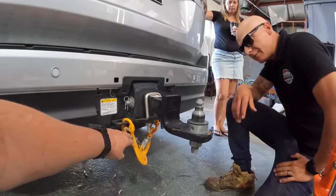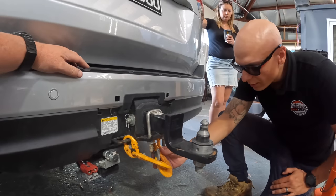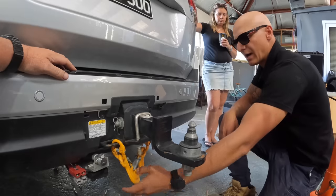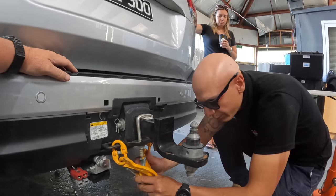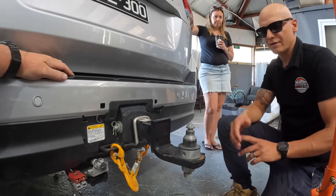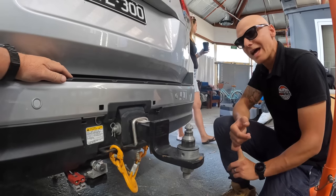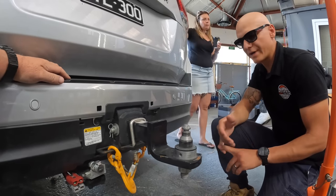Thank you. A couple of questions. These yellow ones here, are these illegal? I've been told that they are. If they're not, there's an Australian standard that they have to be approved to. For towing, yep. These are used for lifting, not for towing. There is a hook called a Mobi hook, and they are approved to tow, up to 3.5 ton.